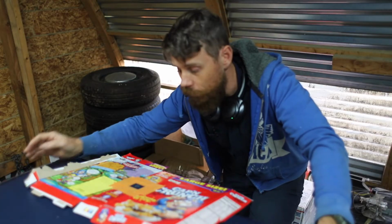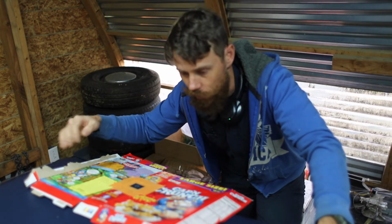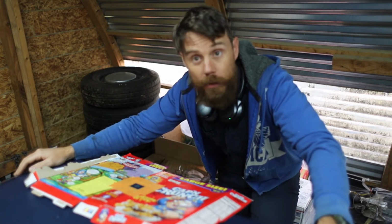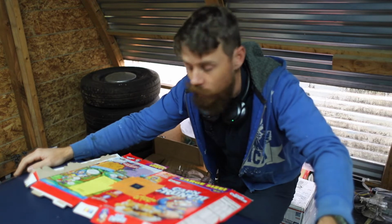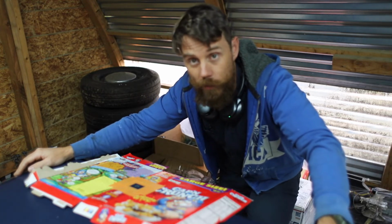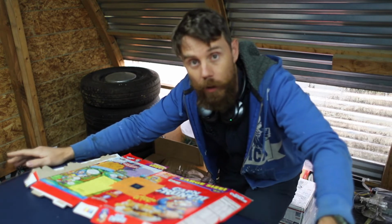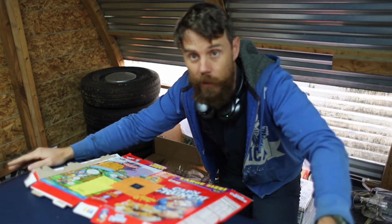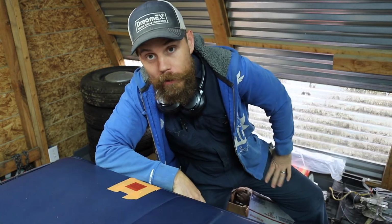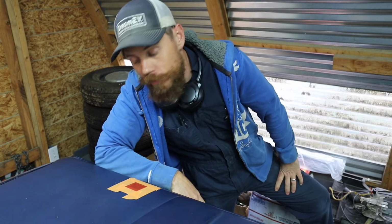Okay, this is one of the medium-sized spots at the back of the van. As you can see, I've got it masked off with some Cap'n Crunch. Hashtag not sponsored yet. All I gotta do is prep it with a little acetone, and then we're gonna start with a base coat of rust encapsulating primer. Got a coat of primer on it, but it has to dry. And before we put something else on top of it, it needs to dry for like 3 hours.